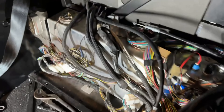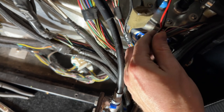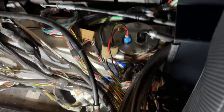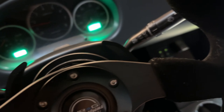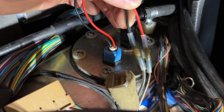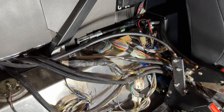The fuel pump did not start up again — that's something to do with these connections right here. It's hit or miss. Let me try the car. I've heard these solder seals get brittle and get questionable connections after a couple years, and maybe that's what's happened. But I've already dug this far, so I'm gonna replace those just in case and we'll see. The pump is alive.